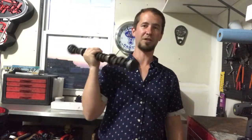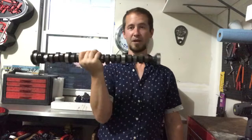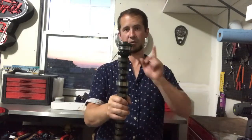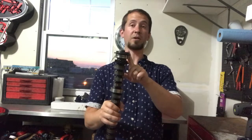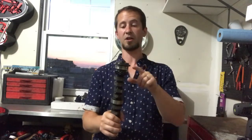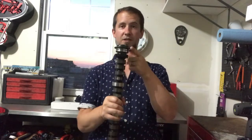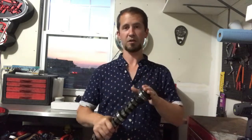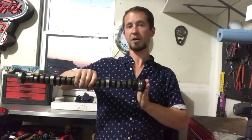This is the camshaft that came in the Galaxy - the one I'm holding in my hand. Because my car's a 1962, it has the pre-1963 cam retainer. That was the first thing I wanted to talk about specifically for this engine. What makes us different is this retainer versus all the other camshafts you can buy from Edelbrock, Comp Cams, everybody else - those are the 63 and later. So this retainer keeps the cam from going too far into the block.